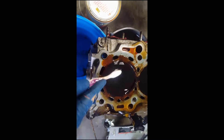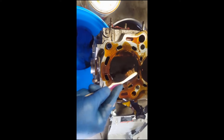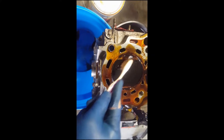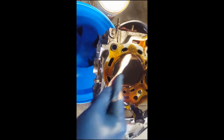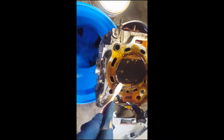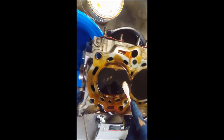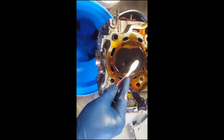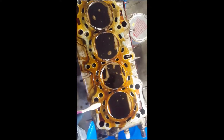After about an hour, I'm just going to go in and lightly scrub the insides with a little toothbrush — doesn't have to be anything fancy. You can already see the color returning to nice bright aluminum and we haven't even done the full time yet. We're gonna go ahead and do this on all our cylinders so the big chunks are loose and can come off, and the liquid can do its magic on the smaller stuff beneath.